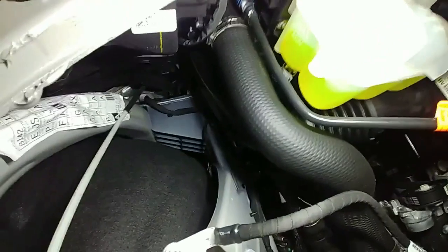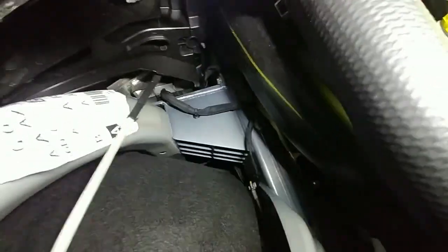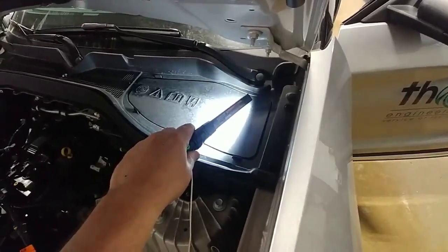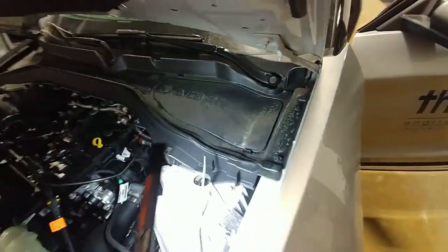The driver's side is much easier — it just comes out down there. You use the zip tie to chase the wire through, then bring your wire inside. We're going to go through the unused rubber boot in the firewall — that boot right there. We'll use a chase strip to get through there as well, bringing the wiring from the battery and the grille lights through that grommet.